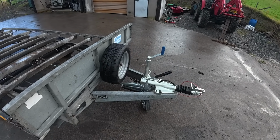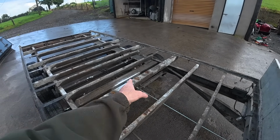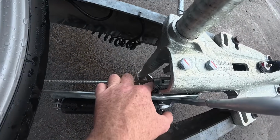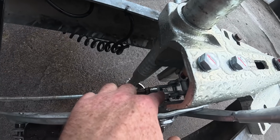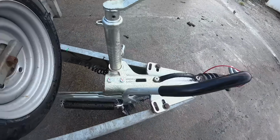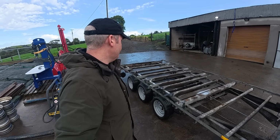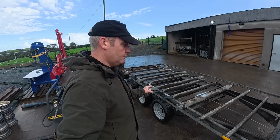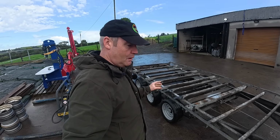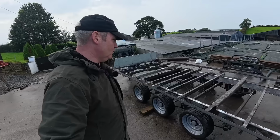That's what generally happens. If I need to adjust it again, which I might have to when the brakes start to bed in, I won't have to go underneath here. I'll make all my adjustment from this nut. By loosening that by there, I left enough thread on that shackle so that I can move this. You can get a pair of vice grips and just turn this back and forth and adjust your handbrake from there from then onwards. It'll need a good journey first, a good drive, and then I'll have to come back to them and probably readjust them slightly again, because when they bed in, the brakes are going to loosen, so I'll need to just probably retighten them slightly. That's normal with any brakes, but the work is done there and the heavy work is finished.